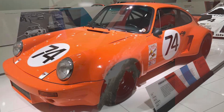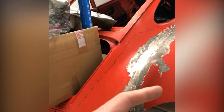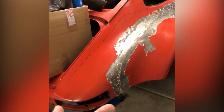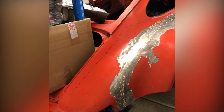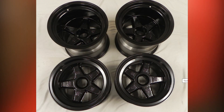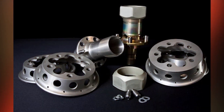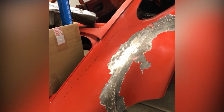It is going to be a street beast — I'm not going to track the car, but I just love the look of that vintage racing style. Purists should be okay with it because the original 3.0 Carrera RSR had glass flares. The problem you run into is wheel choice. You can get BBS centers and make a 13-inch by 15 — that's an awesome looking wheel and probably the least expensive route. You can also get custom wheels made, or run the Maxi Light 9s and 11s but you've got to run big spacers. I really wanted to stay away from spacers. I was looking at those custom magnesium 917-style wheels I showed, but 15 grand for a set of wheels is not happening.